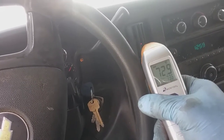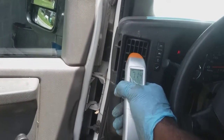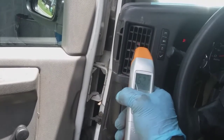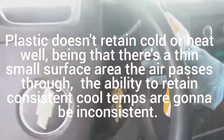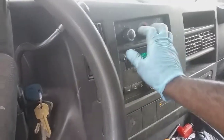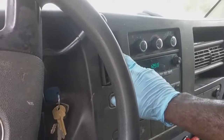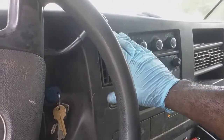Cooler. I mean, it's not gonna be pin spot on, but I haven't had it running that long. It definitely feels below 50 degrees. So it's 65 right there. Boom. If it doesn't hold up, I'll post something else, but I've never had to use a union to seal an AC refrigerant line, though I'm pretty sure it happens. So, all right.